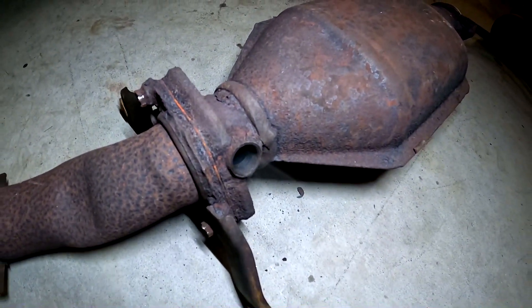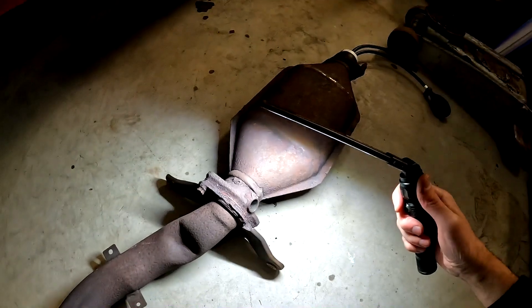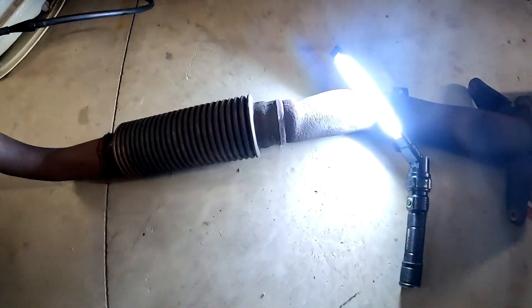Okay, that was quick — it is coming out of the O2 sensor hole. Let me plug that with my thumb and look again for the real leak. As you can see here, there is a crack where the smoke is pouring out of the flexible joint, which is old and crusty from years of use.